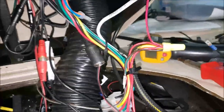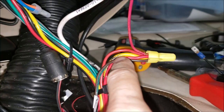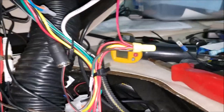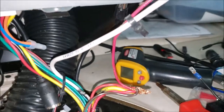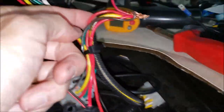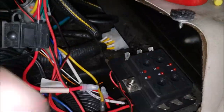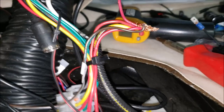There's one more thing I want to address while I'm under here. Over the years I keep adding accessories and I always need a little extra power. I've been jumping off this large wire — it's a 20-amp fused wire that feeds the cigarette lighter, which I use to power little USB phone chargers, LED lights, my fuel gauge, and different stuff. We're never drawing near 20 amps — it's just LED lights and indicators. But I've got a little cluster of wires which is a mess. My idea is to use a junction box — take the large heavy factory wire that's 20-amp protected, mount it to the large nut on the terminal block, then jump off and fuse individual circuits from that. I think that will be a safer and better alternative.